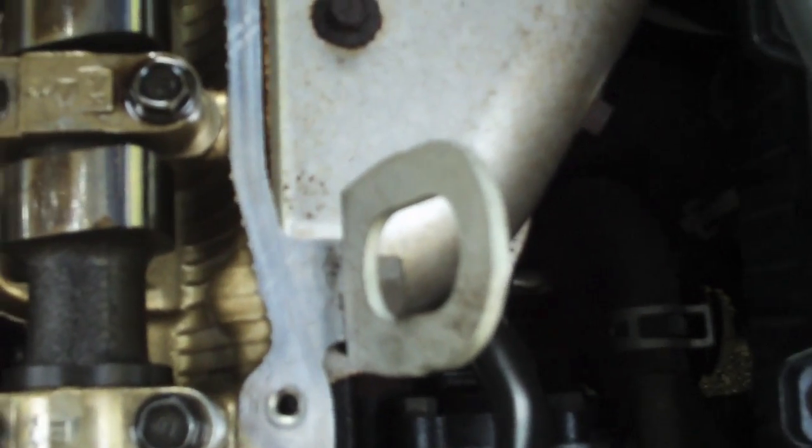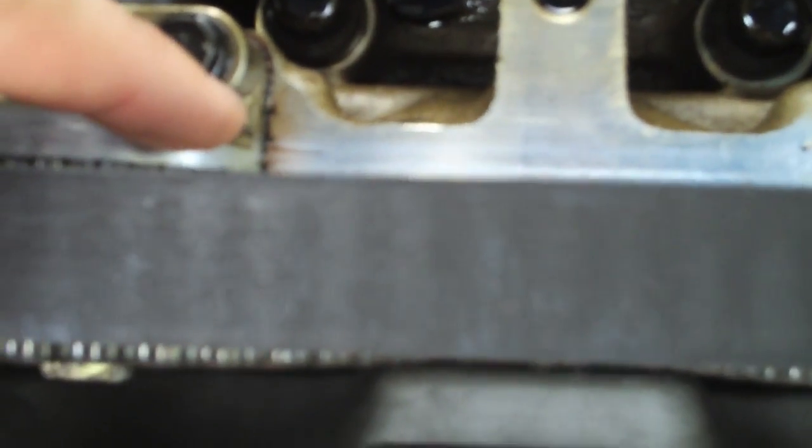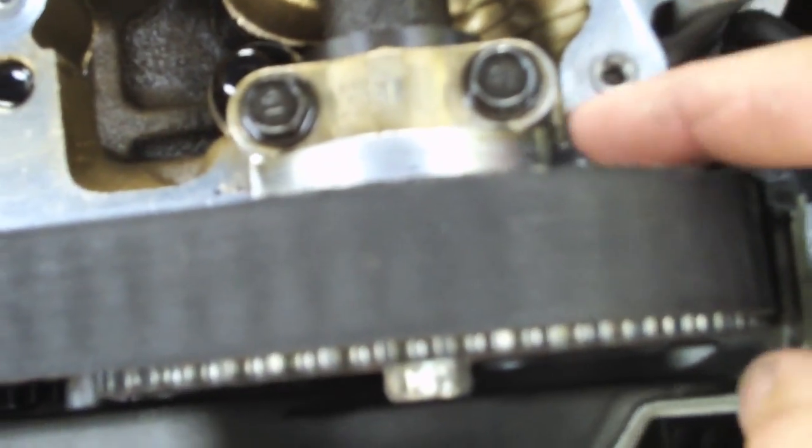There are three critical areas that we need to put that gasket sealant, and it's each of those places where the cams have the rounded edges at the valve cover. Each of these areas that I'm pointing out here in the video. Two at the front, and one in the back. Be sure to clean these areas thoroughly to get any old sealant out of those cracks.